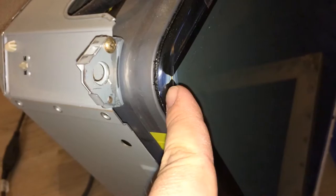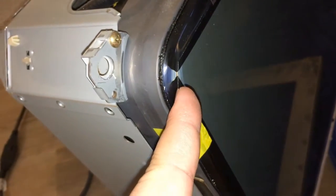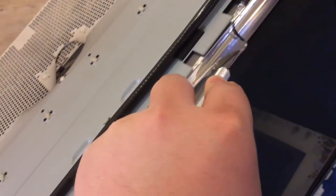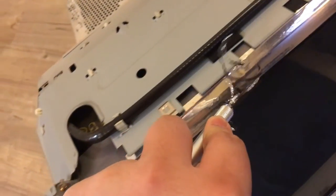Here's the secret: the screen is an anti-glare cover, and probably that got scratched, not the tube. Before we take it off, there's some knifing to do. Gotta cut this foil tape on top — cut firm, but not too deep. The way you would during a breakup.